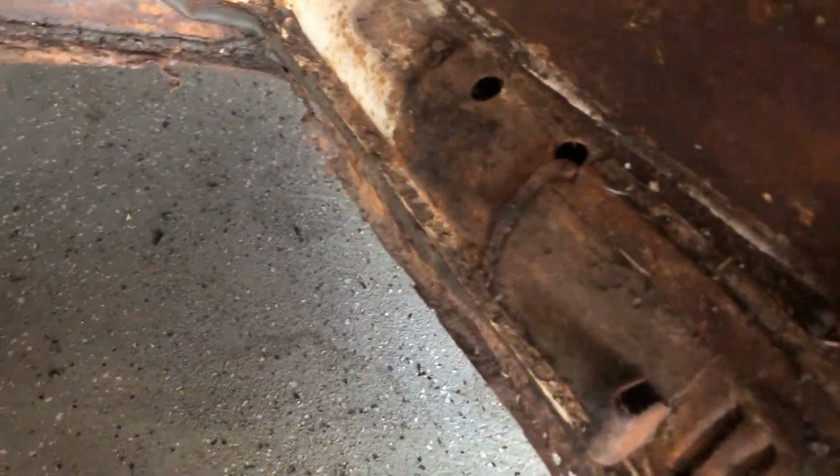Results are coming up better. I know it's a little bit hard to see, but you can kind of tell the metal is shinier. Except where the pitting is at, the pitting is along the entire strip, so nothing I can do about that. I will try to get out as much as I can. But in general, I need to clean up this edge because this is where most of the pan is going to be resting on. The front area, not so much. And this side, of course, is bulb, so I don't really have to clean up that.